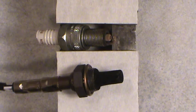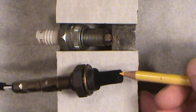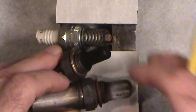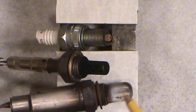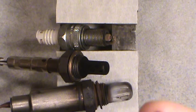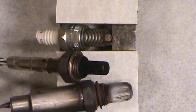You can go back to that for future reference. The correlation between how the plug deposits look and how the oxygen sensor looks — I'll put them side by side just before I sign off here. Mind you, this one was burned with a propane torch, so I'm pretty sure most sensors that come out aren't going to be all black and covered in carbon like this one is. You can't see any metal because of all the carbon coating on there — it's just solid, solid carbon.